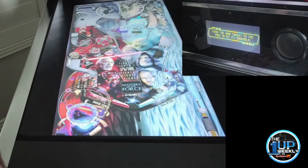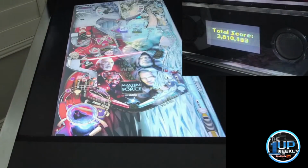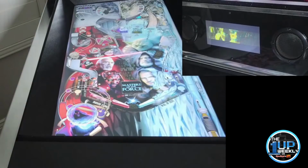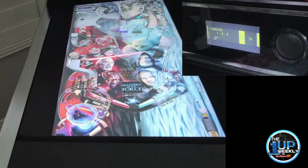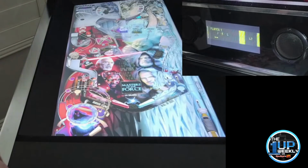So I think the interchangeability is possible because I think the connection is HDMI. So it's a 1080p monitor, but it's operating at 720. Those are standard resolutions, with a standard aspect ratio. It's 16:9. You could swap it out for a different monitor, but what are you going to go to? Like a 27-inch? If you go to a 27-inch, will it even fit? I did a quick check, and a 27-inch, which is the next step higher, is the width of the entire pinball machine. It's like 19 or 20 inches. Here's the thing.